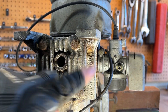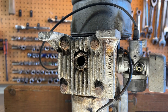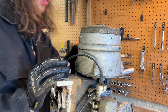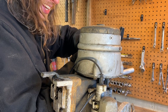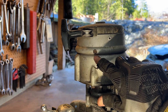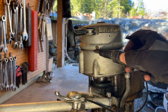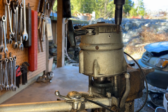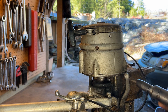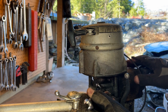For whatever reason on the cylinder head here it says 'don't remove.' Tell me about that - what does that mean? I'll do what I want. Let's try to get this pull start cover off, see if there's a bolt we can give her a spin. There's a flathead screw back here that appears to retain this top cap. I want to try to hit it with the impact driver - now that I'm seeing it, I don't think this is going to come off. I think it's just for rotation, this locks it in like a set screw. To pull this assembly off I think we've got to grab these four screws at the base - seven sixteenths.